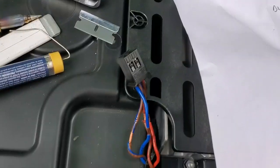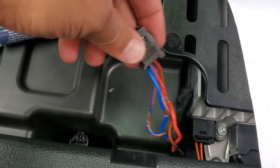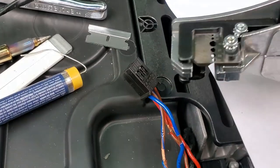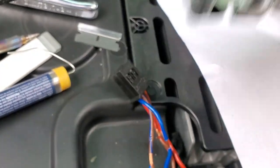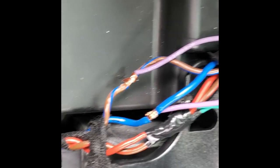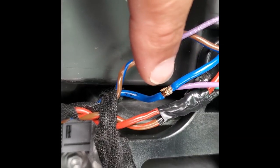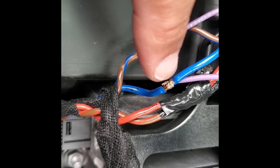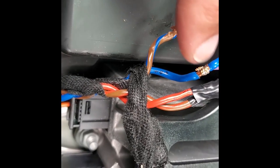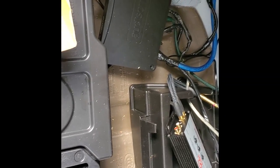These are the wires that go into the sub. What I did was I used one of these strippers to strip the end of the wire, then wrapped the wire around and soldered it — the solder is sucked up into it. I just didn't put it on the top. That makes a nice tight connection because the wire won't spin around or nothing, so it's solid. I just got to make sure everything worked — no issues.